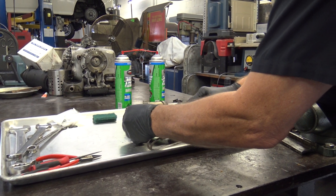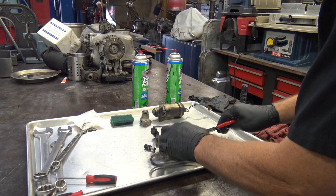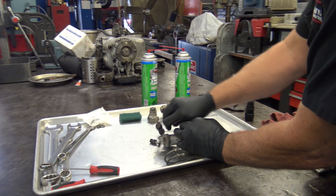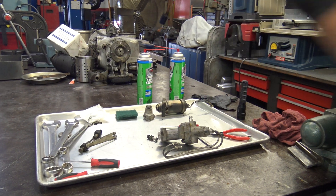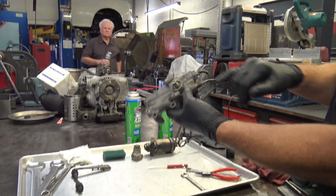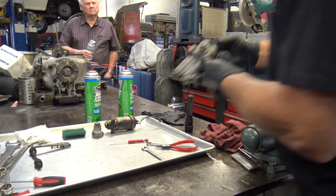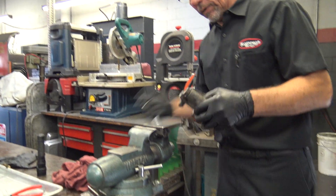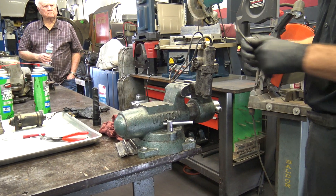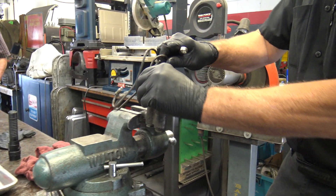So now I'm going to slide this off. The working pressure — normal operating I think is about 1800 to 2200 PSI — it tries to maintain in between those. There's your cinch bolt. Now you can see the shaft that it goes on — you can see it's got a flat on here, so you've only got so much adjustment, but you want to get it as close as possible. So now I'm going to clamp this in the vise, we're going to take apart this end. This upper fitting here, I take that out and disconnect the line completely.